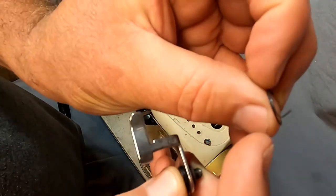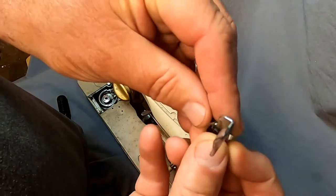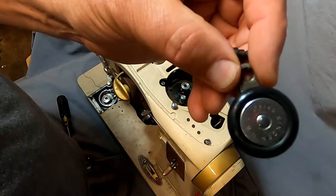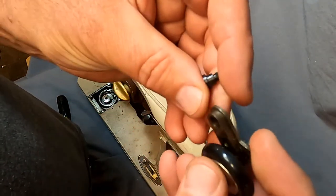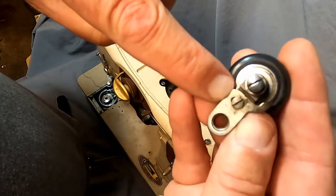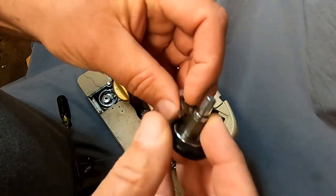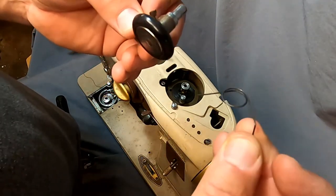This spring has a little indexed upper tab, so we're just going to lay that on there for now. And now we have our winder itself with the rubber wheel — a new wheel on it. This screw here is for adjusting the tension of your tire against the stem that's on the motor. This also has a screw, and then we have another spring assembly.